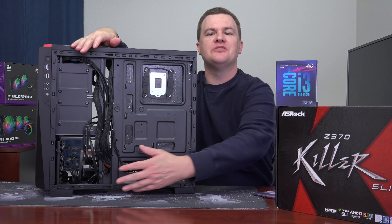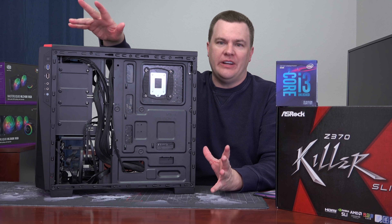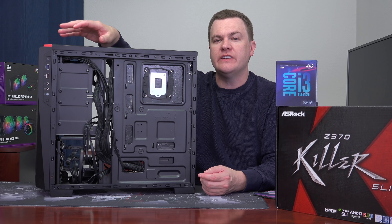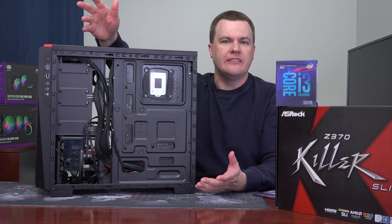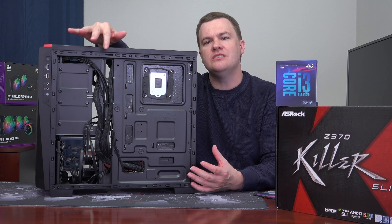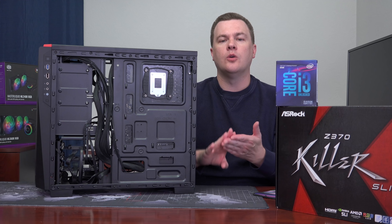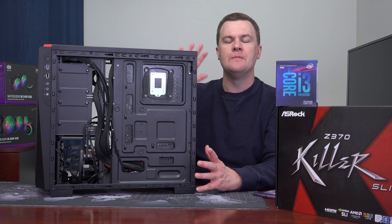You can see the wonderful mess of cables. In the first video I said I was installing one extra SSD that wasn't in the price — I ended up installing three. In addition to the Mushkin Triactor on top, I installed the two Adlink drives I recently reviewed: the S20 and the S50. One is TLC and one is MLC, both 256GB. I actually have those striped in disk management within Windows — not for performance, but to give me a single larger drive rather than a bunch of little ones. This effectively gave me a terabyte of SSD to install the test games: Star Wars The Old Republic, League of Legends, World of Tanks, Rocket League, and Overwatch are actually installed on the computer, not running on my external testing drive.